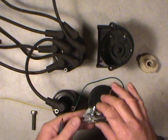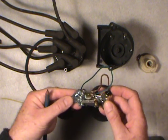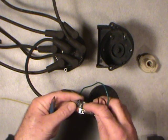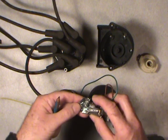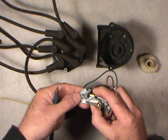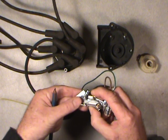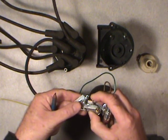This is what they used to use up until about 1974. This is a General Motors point set. It has an adjustment screw here which most other manufacturers never had. It just basically works like a switch. There's a set of contact points in there and they open and close just like a switch, and that's what controls the primary voltage in the coil.